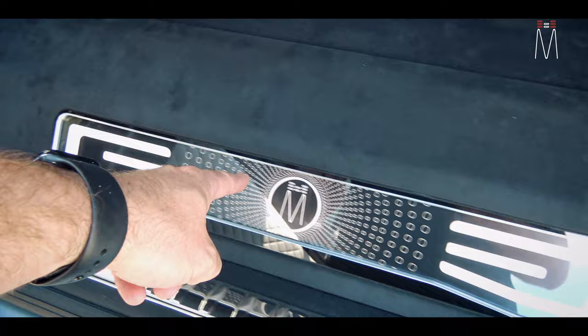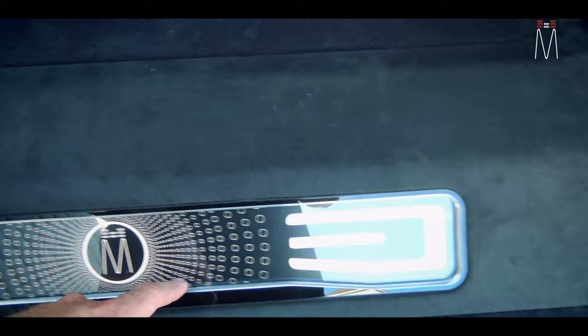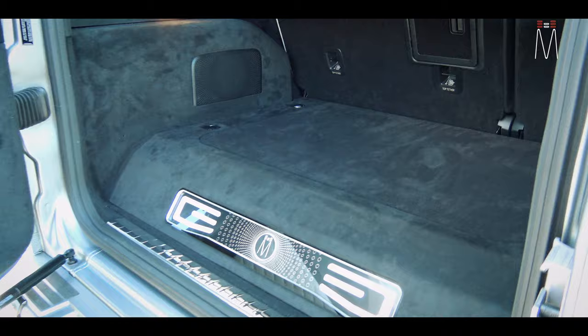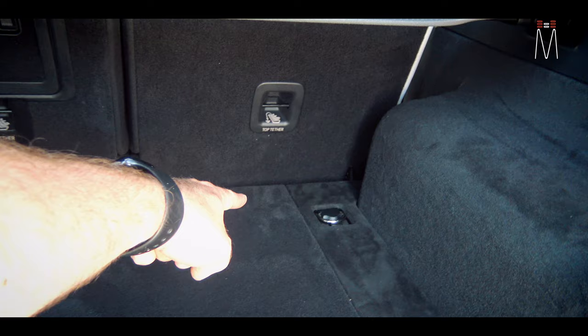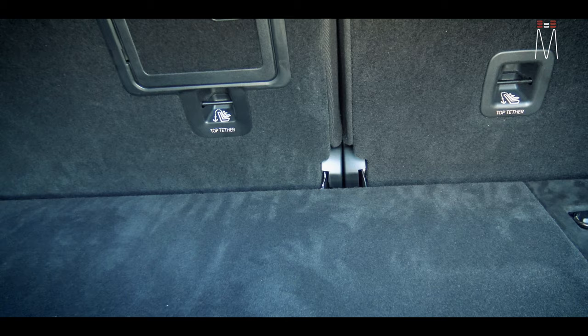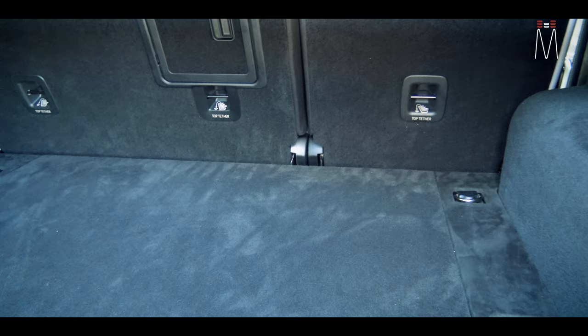It's pretty bright out right now and you can still see all of this lit up pretty well, so the light box idea worked out really great. It's trimmed off with this last piece of trim with a chrome insert to match what you see up front. You still have a lot of usable space and access to this piece up here — we really just got rid of a little bit of space. This bolts down to where the factory tie-downs were underneath, specifically to a steel crash bar that extends across, which had two more tie-downs. The whole enclosure bolts down to that area using the factory screw holes — no new holes, no new nutserts needed.